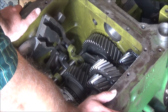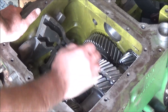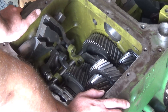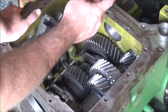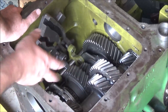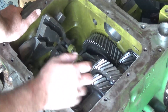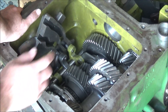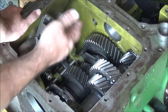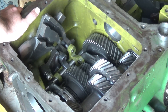Y'all missed the most fun part of this. I didn't have room for the camera in here while all the fighting and cursing was going on putting this bottom shaft in here. There's four select fit snap rings — they have to go on in the exact right order for all this to go together, and you've got to be sure all the collars are turned the right way. It's just a lot to get lined up and there's not much room. Kind of a pain in the butt, but I've got that part in there.